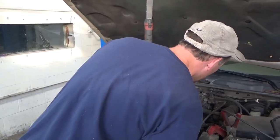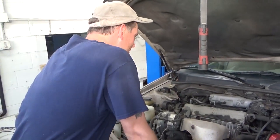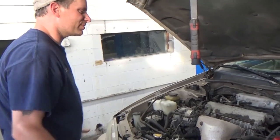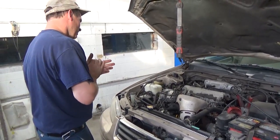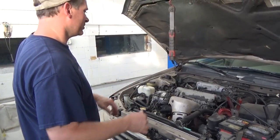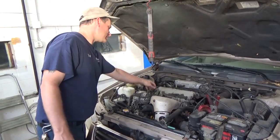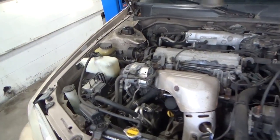I don't see much sense in checking for spark because it's all electronic ignition. However, if the distributor ran off the cam, and the timing belt was broken, it wouldn't be spinning the cam — so it would be a good idea to check for spark in that case. To me it sounds like it has very low compression, and if that's the case I have a feeling the timing belt jumped. It's just a gut feeling I'm having, going off the mechanical sound of the way the engine cranks.